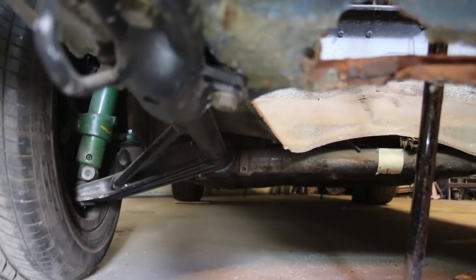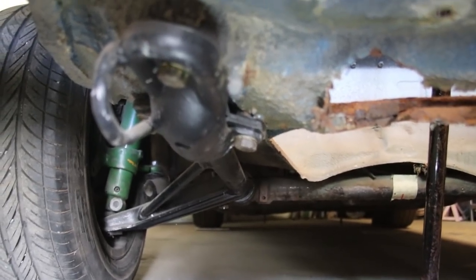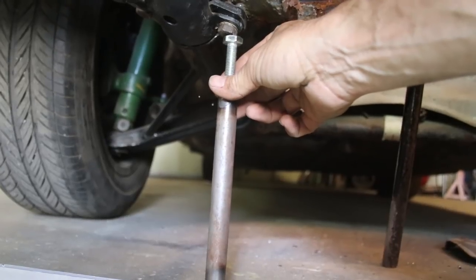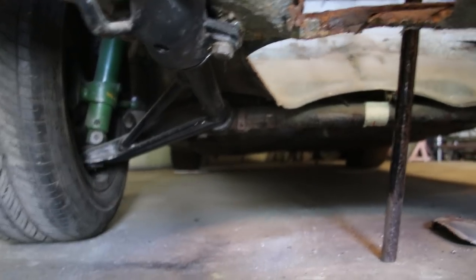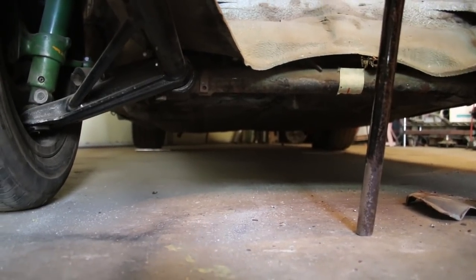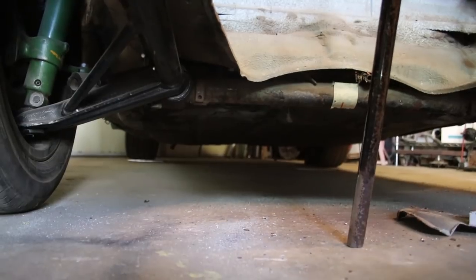I've already gone through this exercise before when checking the rear suspension points. Some of the banging we did to get the hood aligned might have moved it a little bit, so I'm going to whack it back down a millimeter and have a perfect reference before the new pan goes in. These front mounts are now level from left to right. I've already confirmed that the cross member here is level, and I've done that before when fixing sheet metal on the inner fender and floors. Everything from front to rear is level with no twist. Now I'm going to show you how to measure the distance between suspension points.